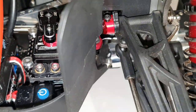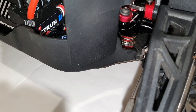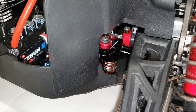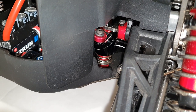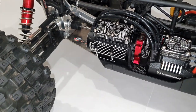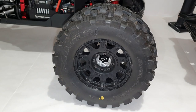There's a Hot Racing steering link along with Hot Racing's other steering parts — they've all got ball races on them, which is why I chose them. A few folk mentioned Kevin Talbot's 'world's toughest truck' build still had a steering problem. I had an Arrma Nero before and couldn't get bits for it any longer, so I was a bit wary running it fast. Now I've got this, I've got carried away wanting to go faster and faster. It's still on a 19 tooth pinion doing about 60-65mph — on a 21 or 22 tooth pinion it should see over 70, especially as these tyres have a slightly larger rolling radius than standard.